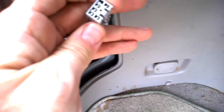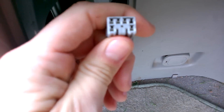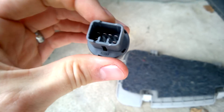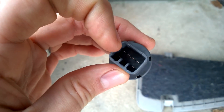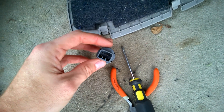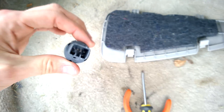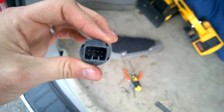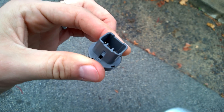You can see there's a wire missing — that upper right one doesn't have a contact, which means the upper right one in here is a dead one. So what I'm going to do is bend these up a little bit and bend these out just a tad. I'll take a screwdriver and ever so slightly bend them out so that when this pushes in it makes stronger contact. Someone online said bend them out like an eighth of an inch — that's also a bunch of crap. If you bend them out that far you'll never get it back in and you'll probably ruin the pins when you try to jam it back in.